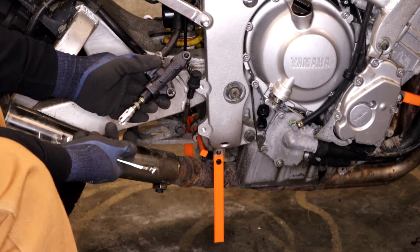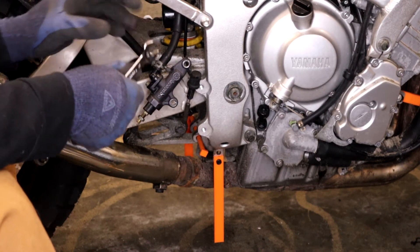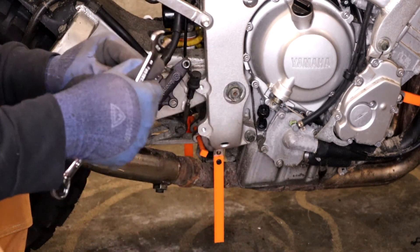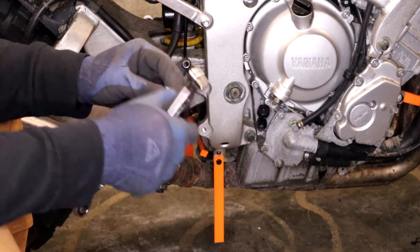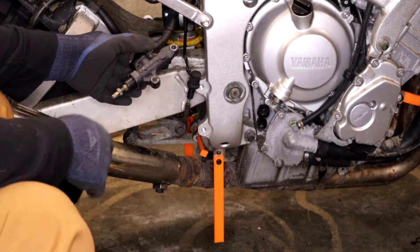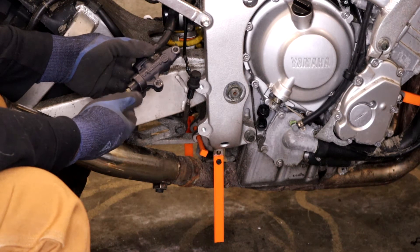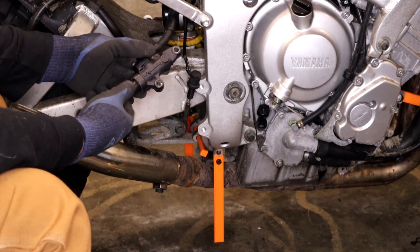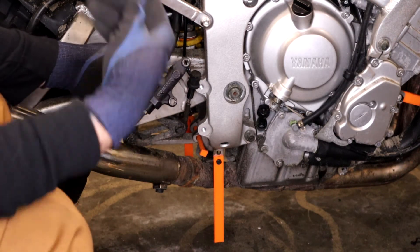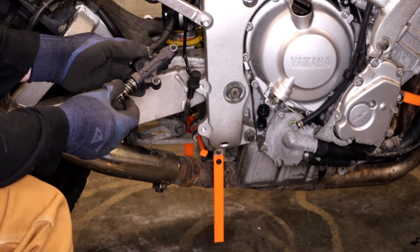So this is normally how you would adjust your brakes on a sport bike. Unlike the clutch, which has a connecting rod you can spin to extend and retract the pedal, this one all you have is this little head and that lock nut. You pull this off and in this case install the spring mount on the top side. This jam nut will act essentially as a preload mechanism for our spring. Slide your spring up and over everything — you might have to work it around the little rubber boot here.